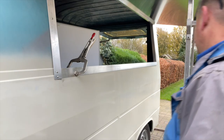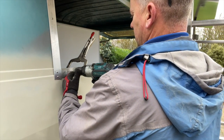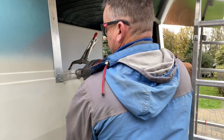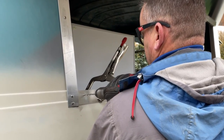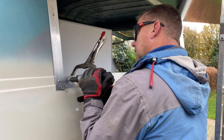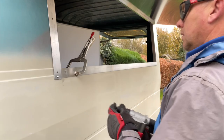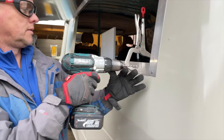So we can see where we're going to drill — we don't want it all wonky-donky down here. It wants to be nice and level. Get them grips on there, hold it all in place. As long as it's the same both sides it'll all look nice. We're going through this outer angle, then the 3mm aluminium plate and the actual side of the van, so it's got a bit of work to get through. A nice long rivet through there. Chuck one in the other side as well and then we'll be ready to mark everything out.